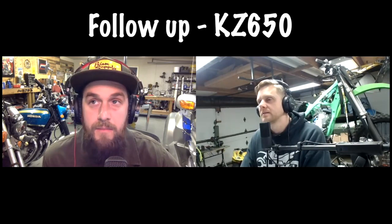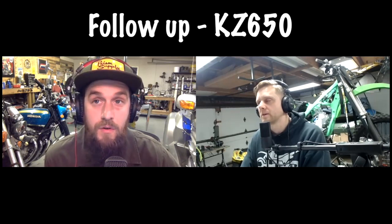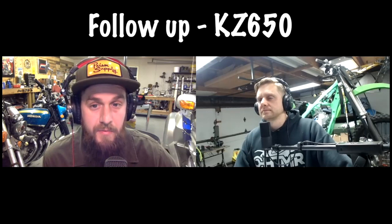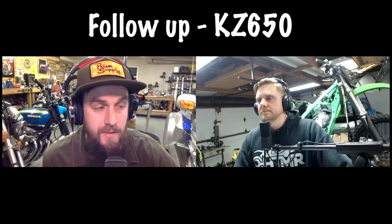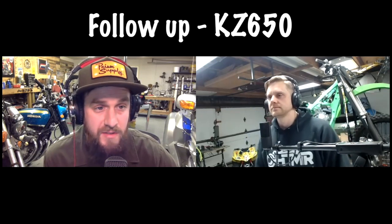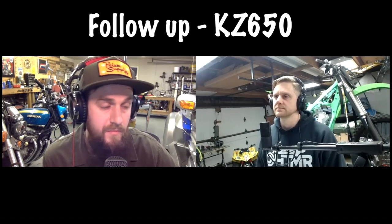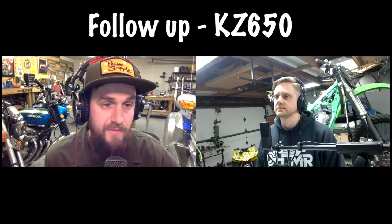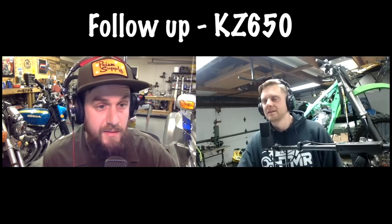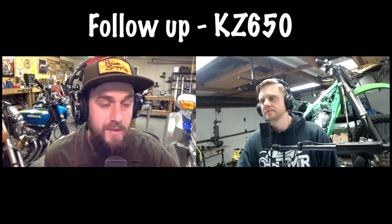Well, I'm going to make a statement that I've seen over and over again. When you have an old bike and you fire it up for the first time after its long hibernation, the bike is going to smoke for a while. There's stuff in the exhaust, stuff trying to get out of the cylinder. I've fired up bikes from the mid-2000s that sat for 6 years, and it smokes the entire shop out until it stops. It's just burning moisture, all this crap that's been inside the cylinder.